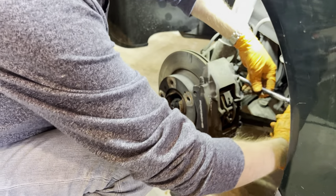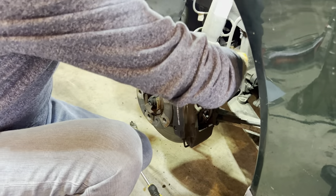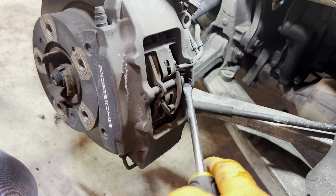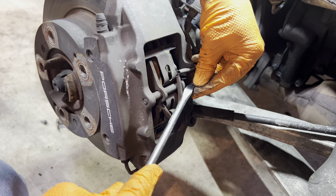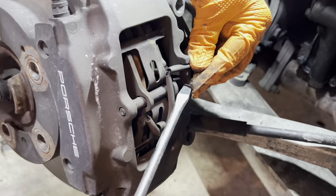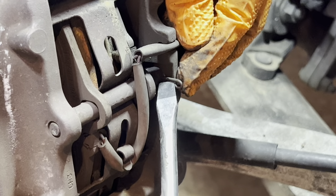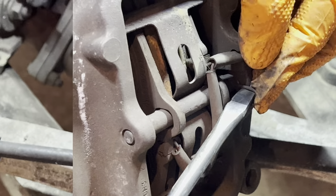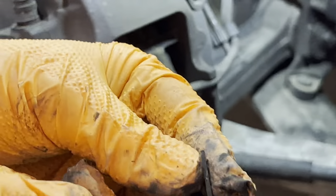This is supposed to be covered in rubber but mine is exposed — the rubber has perished with age. That's our brake pad sensor going all the way around here; we just need to disconnect it. We've come around to the front of the assembly and it's this bolt we need to take off to free up the bracket. It's a 10mm with a little extension — and that just came out really freely. Back with a smaller screwdriver for the cotter pin, and it came out no problem.